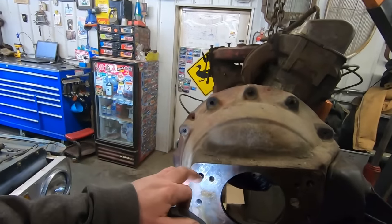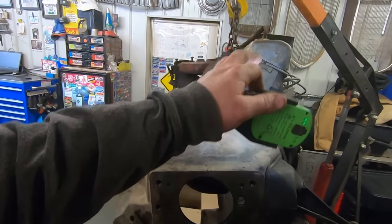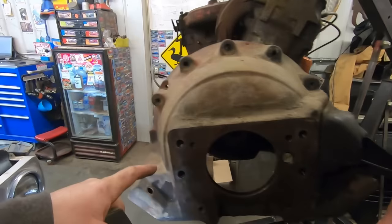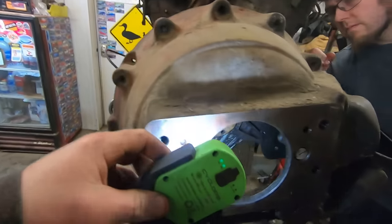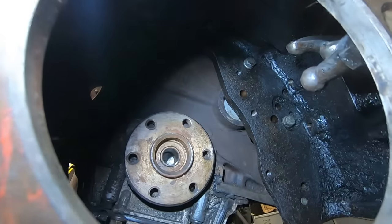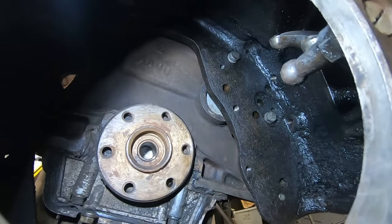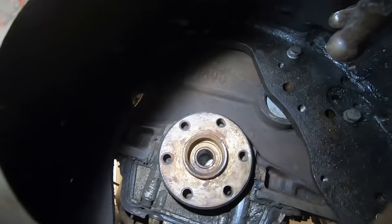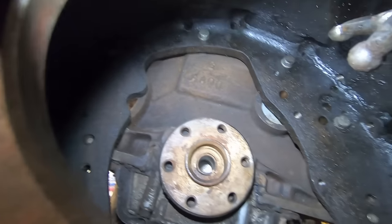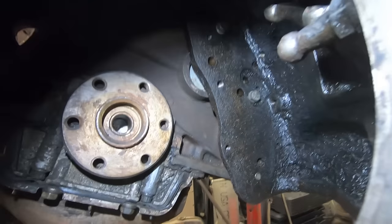All right, so not only are these bell housings super dumb because they sit crooked, because the engine does, and they got 463 more bolt holes than they need, a little bit everywhere. But you can see the bolts, you gotta tighten them from the inside, three of them. So you gotta take the flywheel off to do that. One up there, one over there, and one over there.